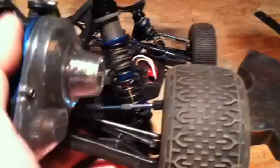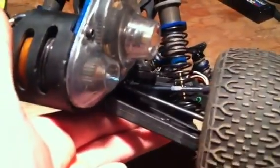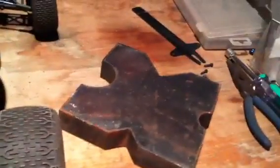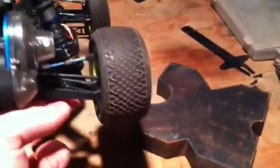This does bind up once I get to about here, but we're not going to go that far. In order to do that I've had to move the link out one hole on the brace and one hole in the hub, but I've done it on both sides so it shouldn't make any difference. I've got two arbor plates, just solid mild steel. They're going to keep the tires from moving left and right to take out the tire contact patch from the equation entirely.